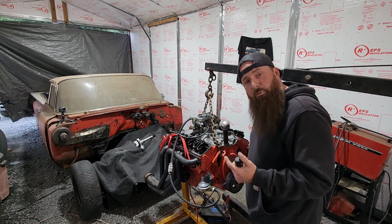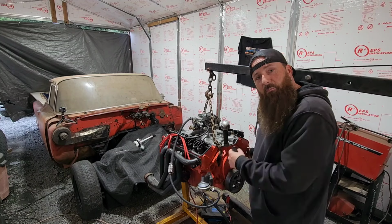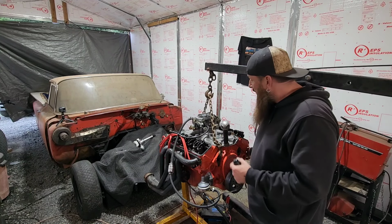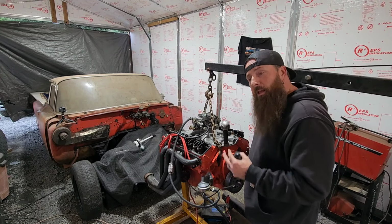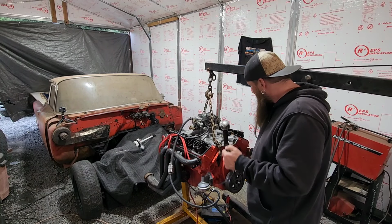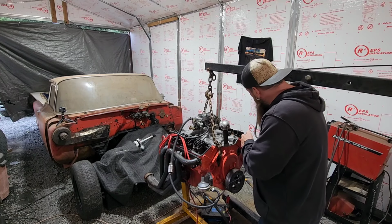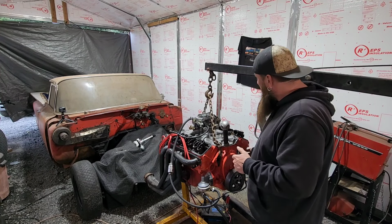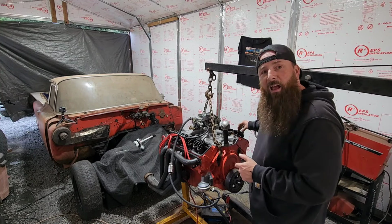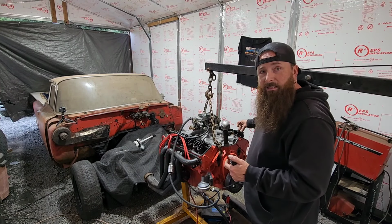Yeah, I could feel the compression stroke. You could hear it with that gallop, being that the plug's out of the cylinder. This is the dead cylinder. As you hear it cranking, you can hear that gallop. That's when it's pushing my finger out. And then I'm timing that and watching these two valves to be closed at the same time. And it's looking like that's the top.